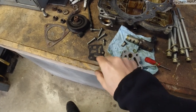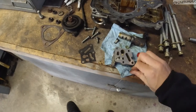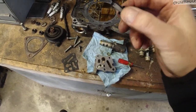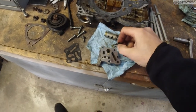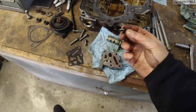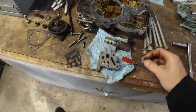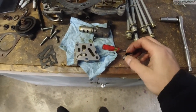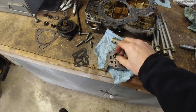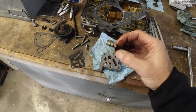This was leaking, by the way. Can't really tell from here. Anyways, you're gonna find this little mesh filter, which sits right in here. Okay, clean this out, guys. Grab it, remove it, be careful. I used a small, tiny screwdriver. Took this out. If it doesn't wanna come out, spin this, pushing these little tabs.